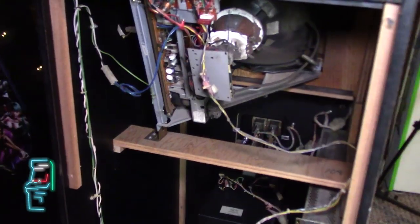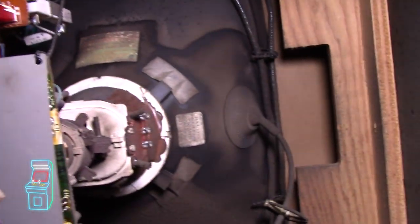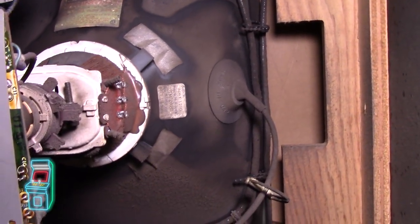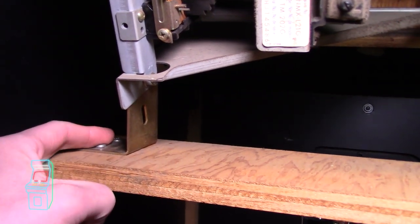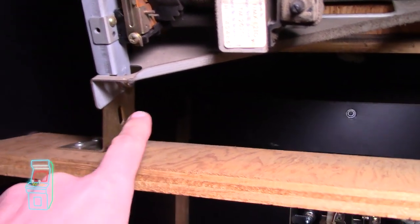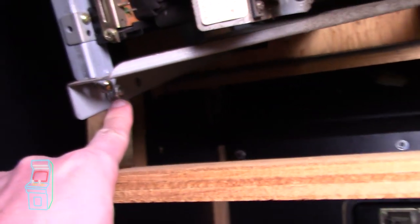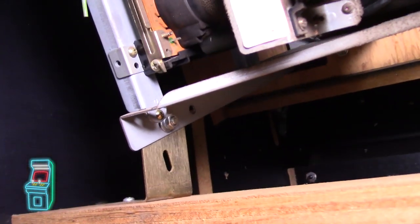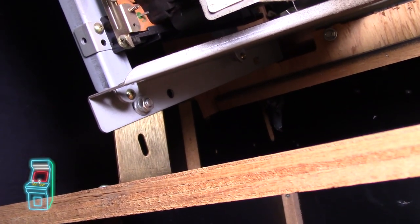At the back of the machine I already have everything out. This is the monitor right here and you take it out through the front — you can't take it out through the back. You have to take these bolts off. There's another one right underneath; you take that out and make it loose, then take out the rest from the front. We'll turn around to the front and I'll show you the rest of it.